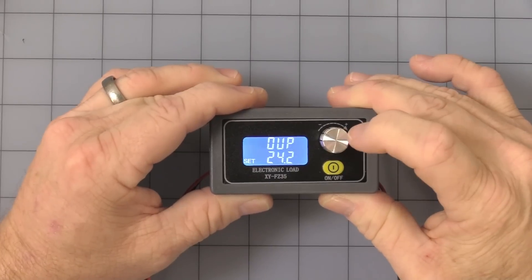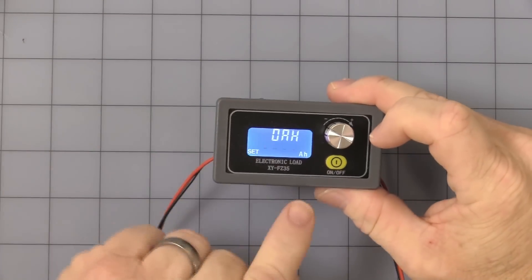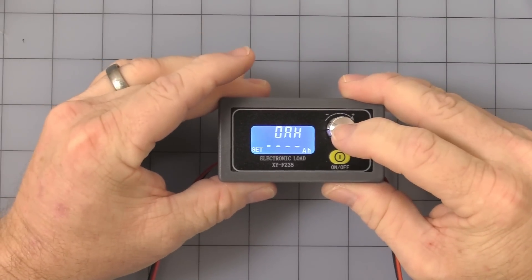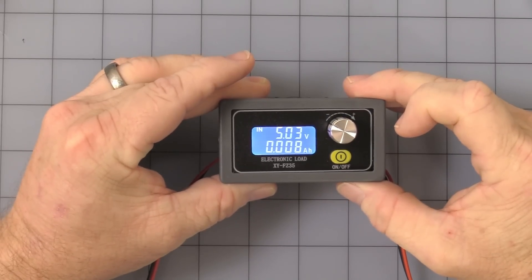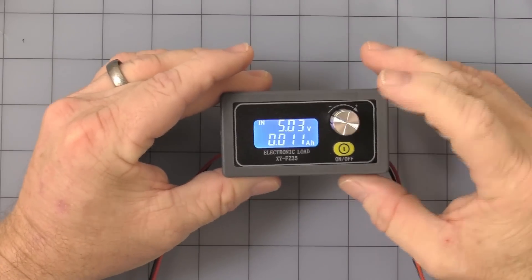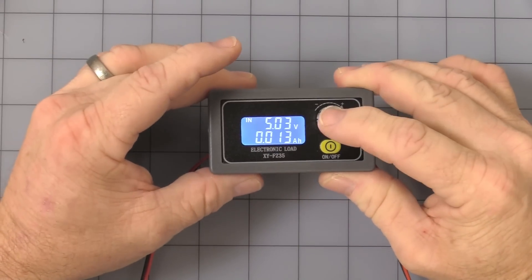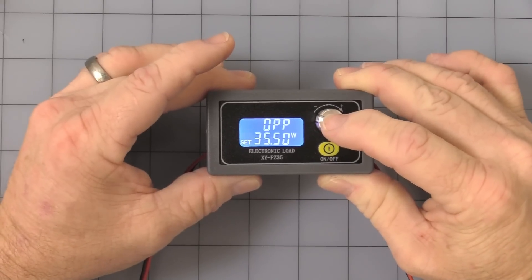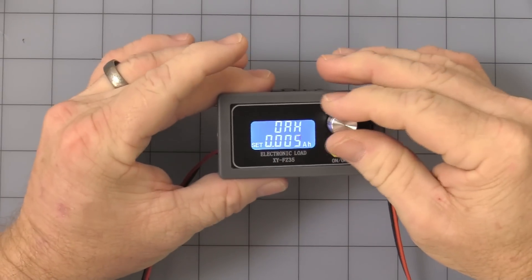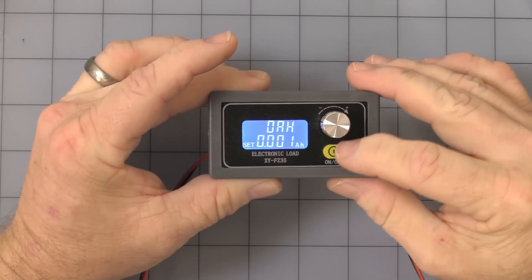What I need to show you — because this caused me a little bit of a problem because I didn't quite understand it — press and hold for three seconds, click once, click twice, then three, four, five. If you have these four dots displaying, it has bypassed that setting. So if it's continuing to run and not shutting off when you expect it to, press and hold for three seconds — it's because you've got the four dots flashing. Press the on/off again, and that's your programmed time setting — then you would press and hold the button for three seconds for operation.